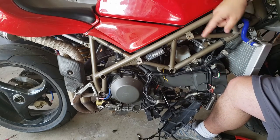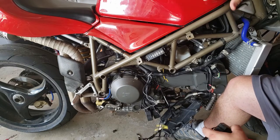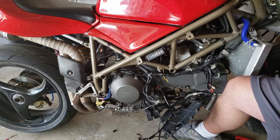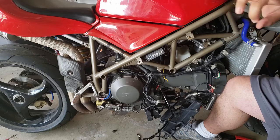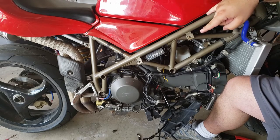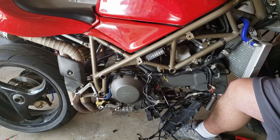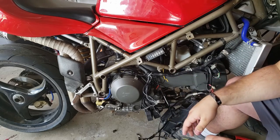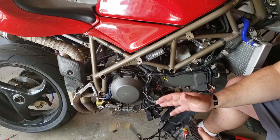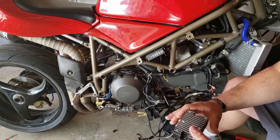Another oddity is that the Haynes manual calls for 20 volts, but even if I give it a little rev up to 1500 RPM, it's still not quite, excuse me, I misspoke, it calls for, I believe, 30 volts, and mine was putting out about 20. So it's a little short, but if you rev it, it'll crank out additional voltage. And so even if at idle it wasn't properly charging the battery, once you rev it, I'm not an electrician,